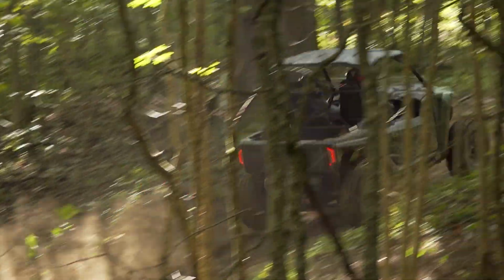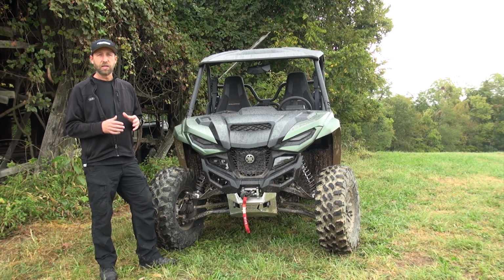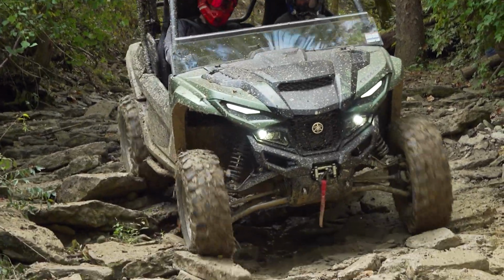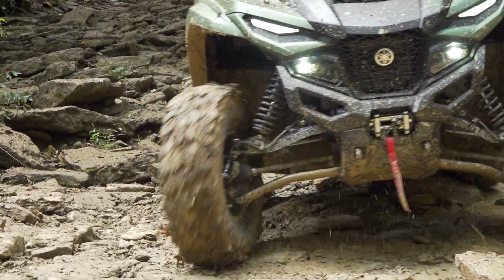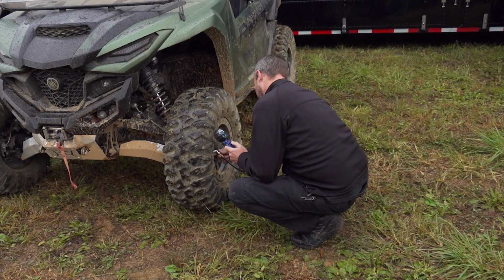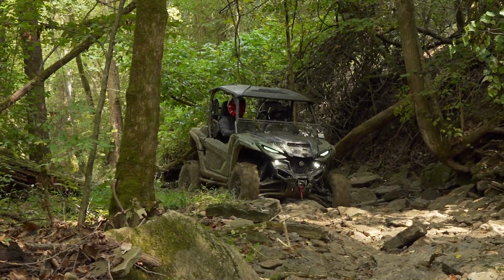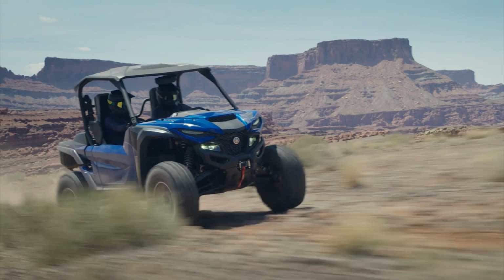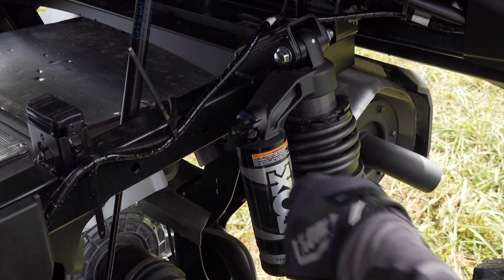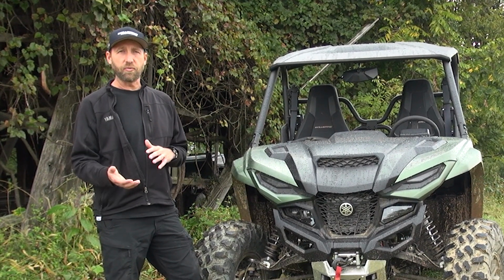We did a lot of evaluation with what we call the recreational cargo load, or 150 pounds in the bed. It really focused on maximizing comfort, but of course maintaining ground clearance and bottoming resistance with that number 2 damping position. If you really want to maximize your comfort, drop it down to number 1 position. You can lower your tire pressure from the recommended 14 PSI down to 13 PSI. It's really going to improve the low speed comfort. And especially on the West Coast, with higher speeds and bigger bumps, you're going to bump it up to number 3. That's really going to give you a nice balance of a real high quality damping feel, good comfort, but excellent bottoming resistance.